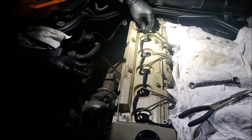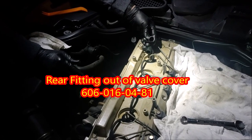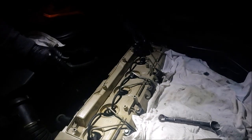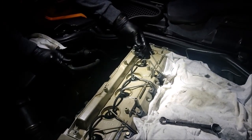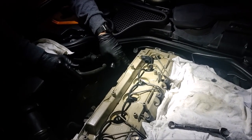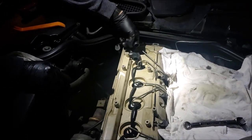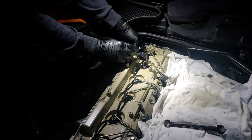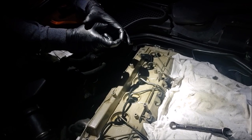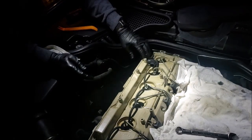The other one to be careful of is this one over here that goes down into the valve cover. When you're removing that, you're probably going to have to pull it apart — mine actually did. I'd heard the horror stories about that, and sure enough, as I was pulling it apart, it fell down in. Luckily it's relatively accessible with a coat hanger and I got it out. What I'd suggest is you break apart the top half with some sort of a knife and cut the circle so that you can pull it up and out so that it doesn't fall in there. That's one of the things I caution you about.